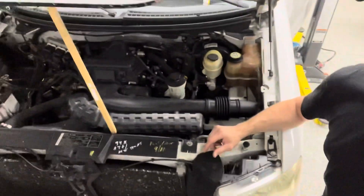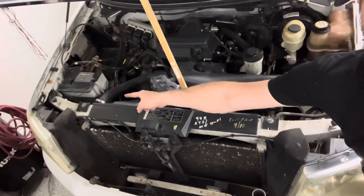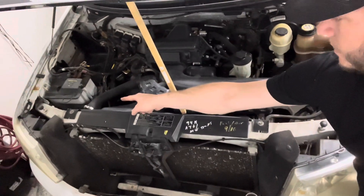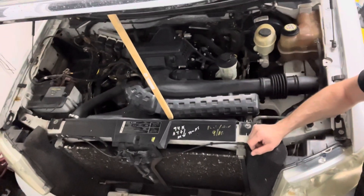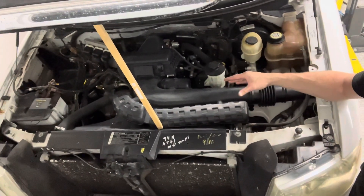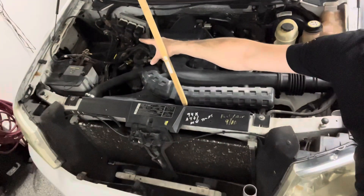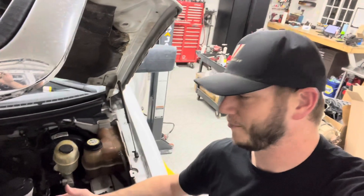The radiator hose over there looks like a quarter inch diameter bigger than what Coyotes use. When I was looking at this thing, I noticed there's like no main wire plug going into the engine bay to disconnect besides the PCM. So I feel like pulling this cab is going to be stupid simple — it's six mounts. What I think I'm going to do is pull the bed with the lift, roll the truck out, probably drive it out, and then drop it on some furniture dollies.